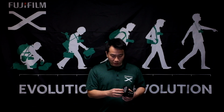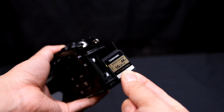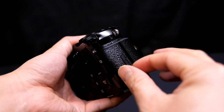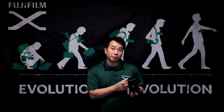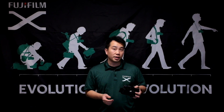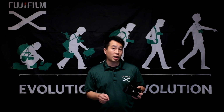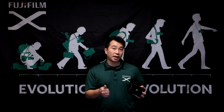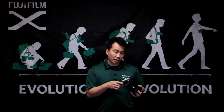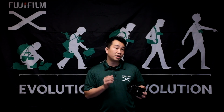Now, on the side of the camera lies the memory card slot, and now it's actually up to 2 cards. The X-Pro1 initially had the memory card slot with the battery in the bottom. Now that you have this camera on a tripod, you don't have to open up the camera in order to change the memory cards. Slot 1 supports cards up to ultra high speed 2, supporting SD, SDHC, and SDXC compatible cards. Then you have slot number 2, which supports speeds up to ultra high speed 1 card and below.